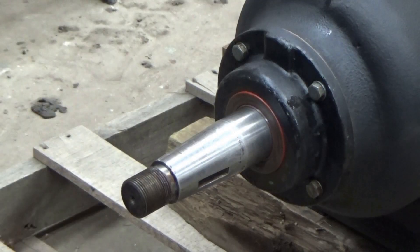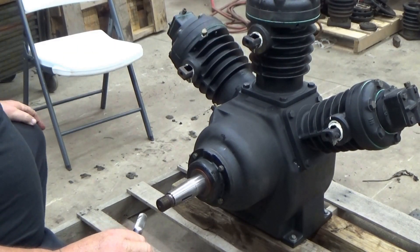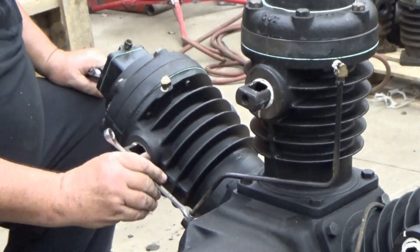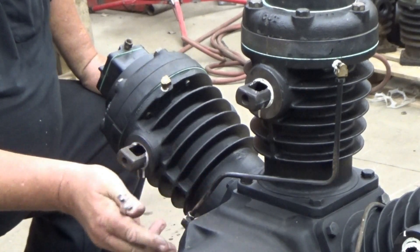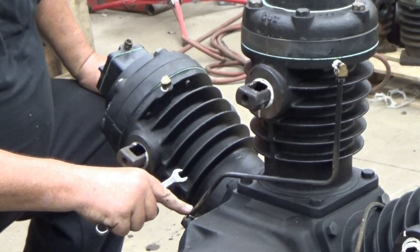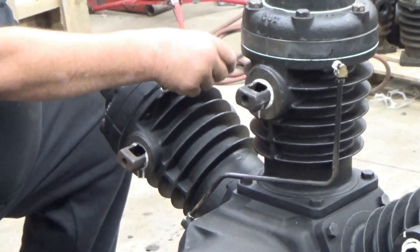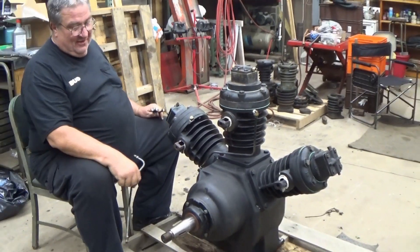The other thing I've got to do is, before we put the intercooler on, we want to make sure this line — the line goes from here to here — and we've got to put this fitting in. You might be asking yourself, why are we putting this line on before we put the cooler on? When we put this cooler on, this is not easy to get to. That's why we're apparently doing a few things out of order. This one is much easier, and we'll do that when we do the other side.